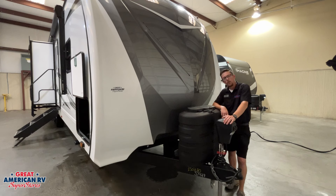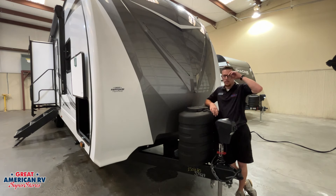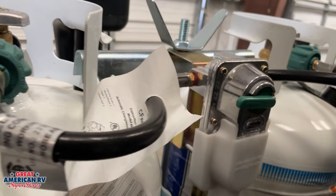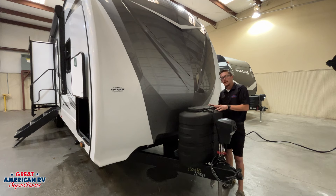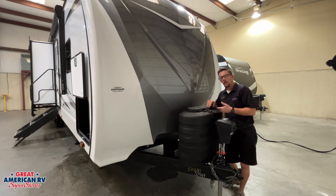Behind that we have our dual propane tanks under this cover, operated by our dual propane regulator. That operates with both tanks on — we choose which tank we want as our primary, and the gauge will read accordingly. Once that tank runs dry, it will automatically kick over and start pulling from the secondary tank. Your gauge still reads on your primary until you swap that selector over, at which time you can get the former primary tank refilled or replaced.